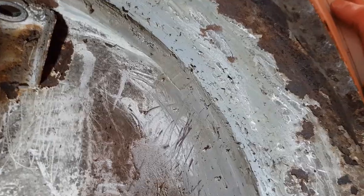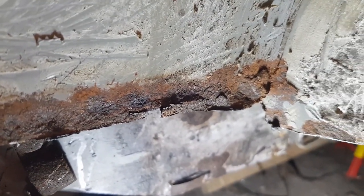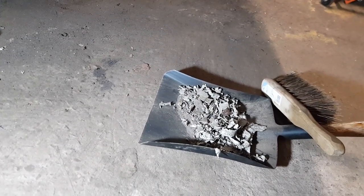Very slow process but things have to be done. That's about all I can do with the heat gun and scraper for now — the rest I'm going to hit with the wire wheel. It's really interesting — in this corner that gray is the original primer of the car, and I've actually scraped through to bare metal here which is solid, but then you've got rust where it's failed, where the underseal has given up. Fairly solid overall — the only really flaky bit is that corner. Right, get the wire brush on — which is even messier. Dustpan and brush — one of the best tools you can have if you're doing a project like this.